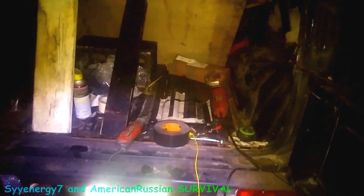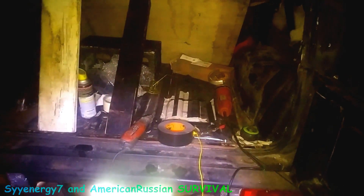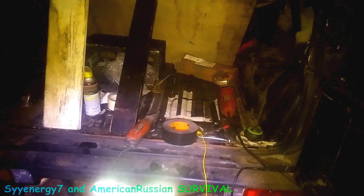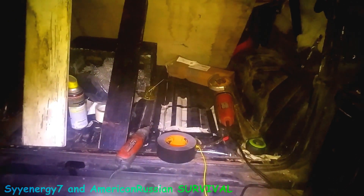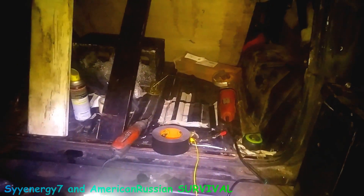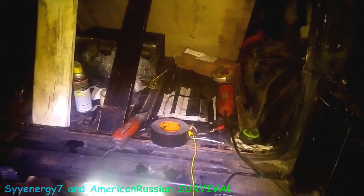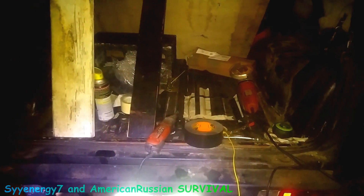It's not that hard to drop the tank, but if you have the trailer hitch and skid plate it does become a pain. I'm glad I did it this way because I realized I didn't have the little screws with me - if I didn't do it this way I'd have to drop the gas tank again just to replace the screws. This is the fast and easy way. When you're cutting through that steel, remember there are hoses underneath - do not cut too far down. Make sure your cutoff wheel only goes just enough to cut through the metal. I finished up with a Dremel to make sure I didn't cut any hoses.